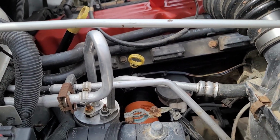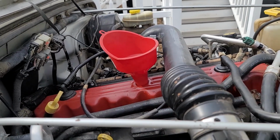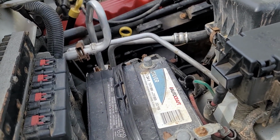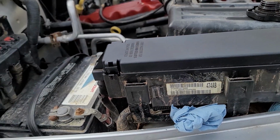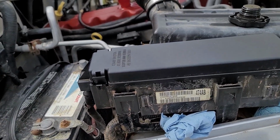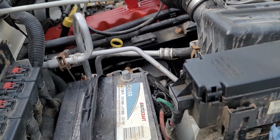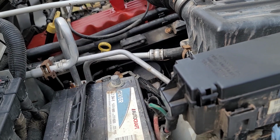Normally I would go ahead and start the engine up afterwards, get a good circulation of it, but we got other stuff going on. Oh, and that's the other thing. Normally, to start with, I would have brought the engine up to operating temperature before draining it. You want to make sure you're getting as much of the deposits out, as much of the oil running down from the top, and the hotter it is, the more it's going to run. Reduces the viscosity of it, gets it to actually drip down. With this one, again, it was sitting with the oil pan emptied, and it's been sitting for weeks, so doesn't really matter. Not a big deal.